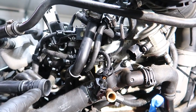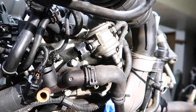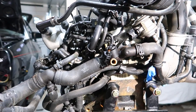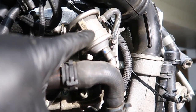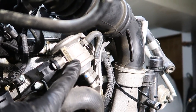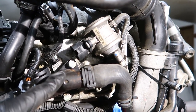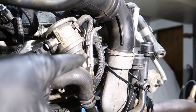Your secondary air pump usually had a hose going into the combi valve. Now that we have the secondary air pump off and all the hosing off, this is the combi valve — this is what we're going to be taking off next. To get to it easier, we're going to be taking off this piece right here, these two bolts, and then we'll move on to taking off the combi valve.